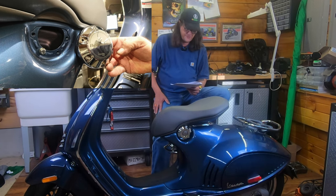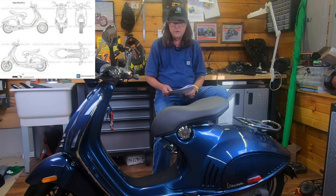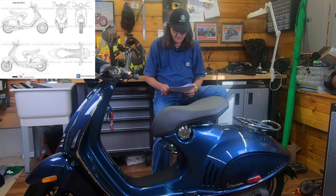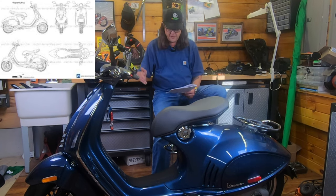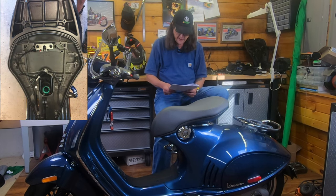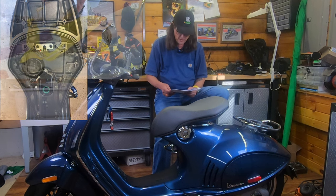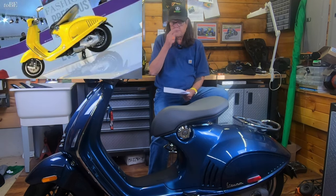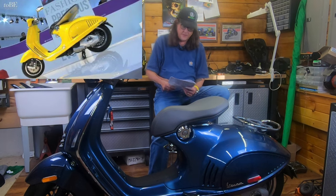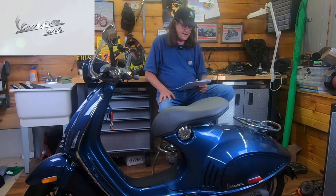The 946 is a physically small design and is initially available with a 125cc or 155cc motor, depending on where you live. Same motor, basically, with a 52mm or 58mm bore. Most of the world is being offered the 125cc variant, which broadly meets learner regulations, but North Americans are receiving the 155cc version, which meets interstate requirements across the USA. This bike has about 12.7 horsepower on tap, while the rest of the world that gets the 125 gets about 10% less, or 11.6 horsepower. So this isn't a very Italian statement.